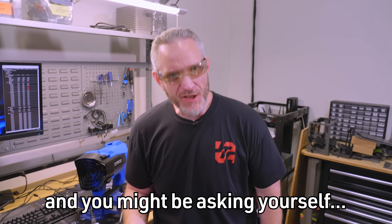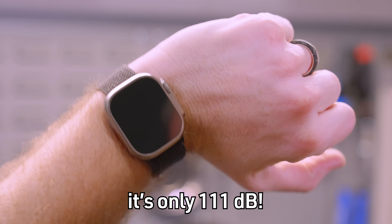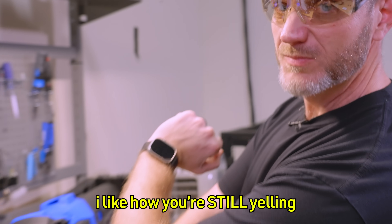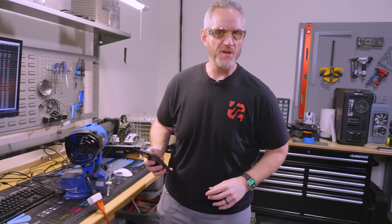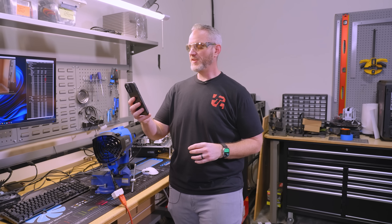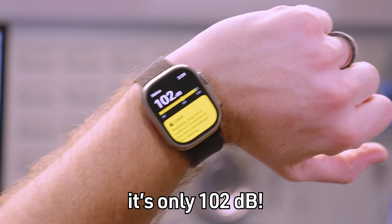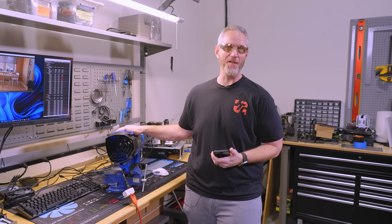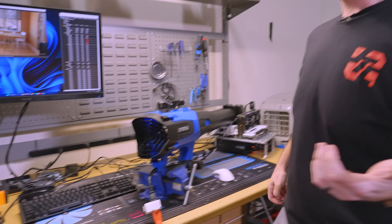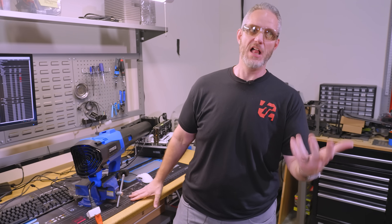You might be asking yourself how loud it is — it's only 102, 111 decibels. According to the California Department of Motor Vehicles, a California-equipped automobile shall not exceed 95 decibels. So at 102 to 111 decibels, this is not California legal. I know it's very difficult to hear over camera how loud it is — my throat hurts from yelling.